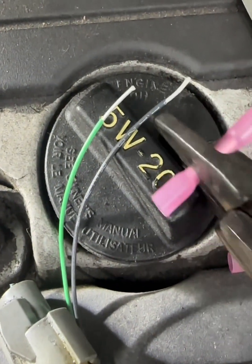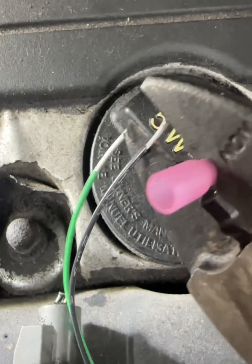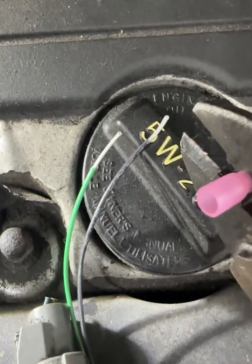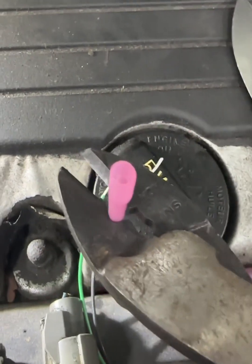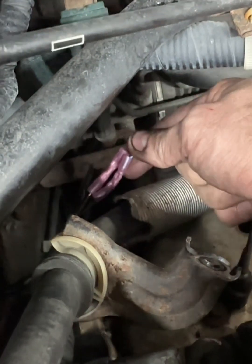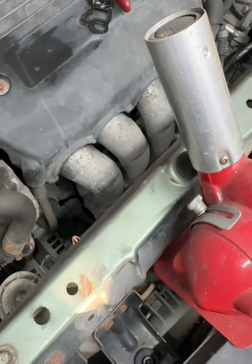The wire being used here is really high quality — it's pre-tinned, so if you want to go ahead and solder it in you're welcome to. I'm going to use these heat shrink butt connectors. The butt connections are made; let's go ahead and get the heat gun running.